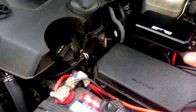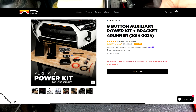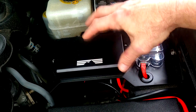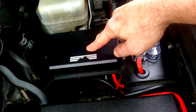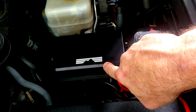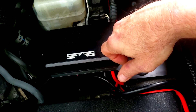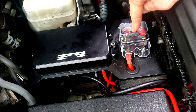Now, what I've since purchased — and this is an option you can do — I bought this little auxiliary power kit. It's got a big breaker on it and it's made for hooking up electronics to your car. With mine, somebody hooked up a whole bunch of lights: roof lights, side lights, ditch lights, front LEDs, rear LEDs — all kinds of stuff. But you can actually customize what you hook up to this. All your wiring connects up underneath here into eight different options — two 5-amp, two 10-amp, two 20-amp, two 30-amp fuses — and you have an 80-amp master breaker. You can change those out; it's just an electronic brick to hook wires up to, so you can mix and match however you want.